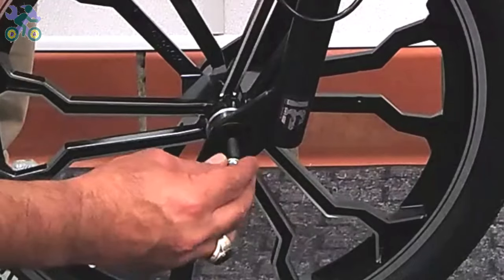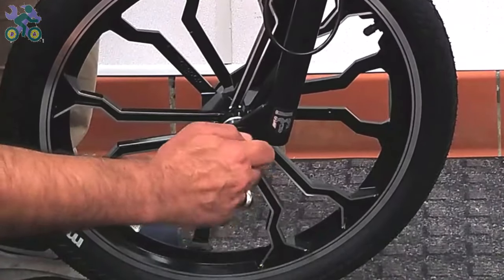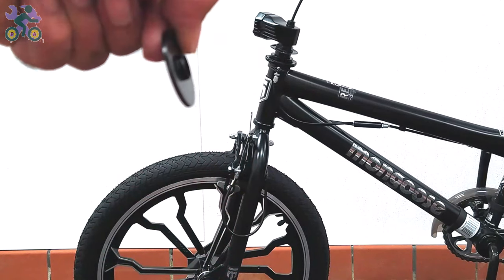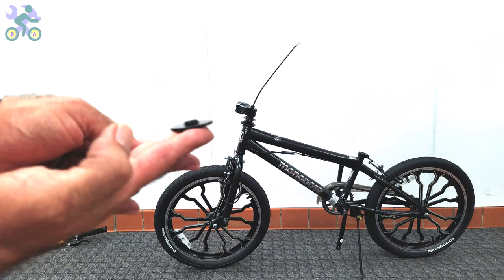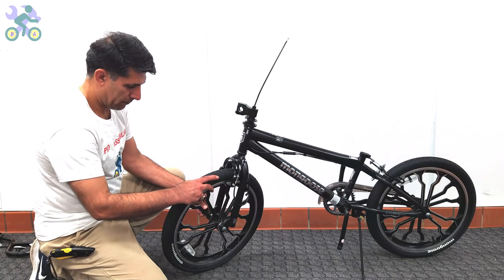Insert the wheel retainer into the hole and tighten the head nut by hand. In only a few limited models, only washers are used for the wheel retainers. Repeat the same process on the other side. If the fork was bent and you couldn't put the tire in the fork, I made a video on how to fix it, and I've put the link in the description section below.